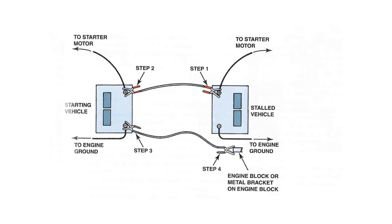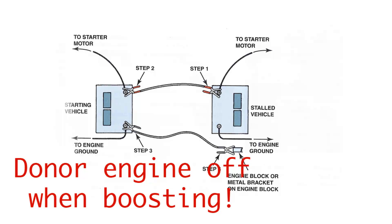The good news is that you boost the accessory battery pretty much exactly the same way you do with a normal vehicle, and you follow the same specific order we all memorized at automotive school. First you hook up to the stalled vehicle's hot pole, then the donor's hot side, then the donor's ground, and then finally hook up to the stalled vehicle's engine. Lexus emphasized that the donor vehicle should not be running when you boost. In conventional vehicles that can be a problem because of the huge amp draw when trying to quickly charge and start a disabled vehicle. But because the small Lexus battery doesn't power the starter, the risk of draining the donor battery is lower. Lexus doesn't want the donor vehicle running because they want to avoid damage to sensitive electronics caused by voltage pulsations from the donor vehicle's alternator, and they don't need the typical 14.5 volts seen in a running vehicle — 12 volts is fine.